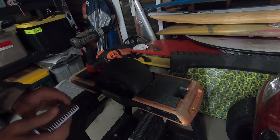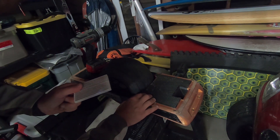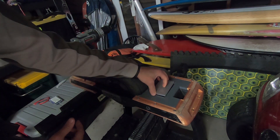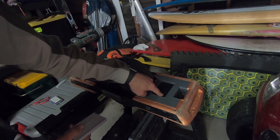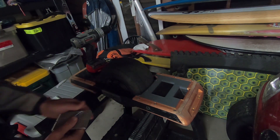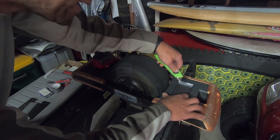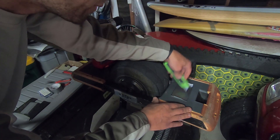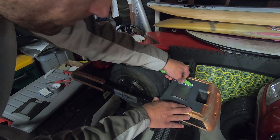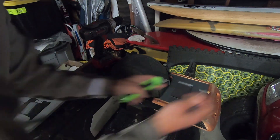Here's how we're doing it. We've got our heatsink. This is the old center plate of my two-piece skid plate design, and I've replaced that with one with a cutout. So this is where the heatsink fits in. You just need to cut a hole with the Dremel and then connect it to the original heatsink that's already in there. I'm not very good with mechanical stuff, but I put some duct tape down and cut that out — that way I know where I need to cut.